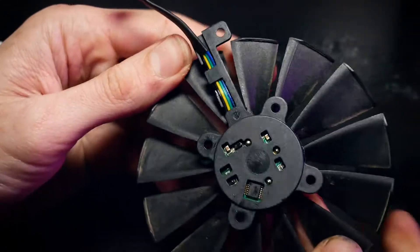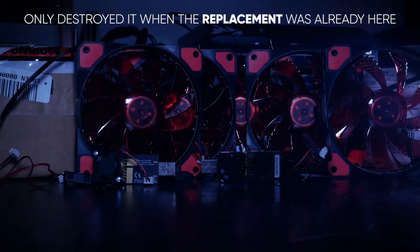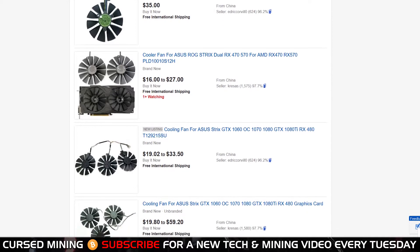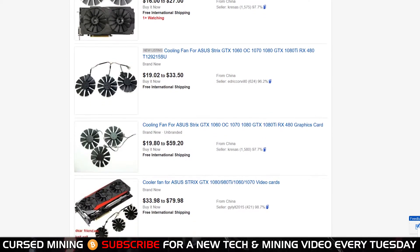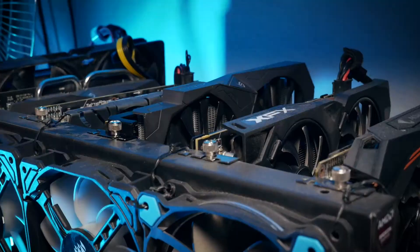That indicates something inside has broken. Some fans can be opened completely but you have to be really careful as they can break. So besides custom coolers and re-smearing, we get to the last resort which I had to do this time — order a replacement fan. For most popular cards you can find replacement fans on eBay. They are never new but rather used or refurbished parts. For this card I could find a single fan for under $20, though shipping from China did take some time and I took the card out of service for that period.